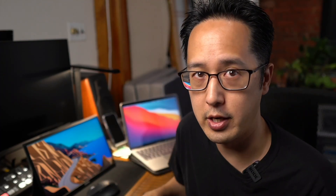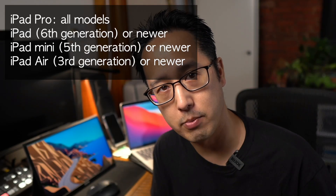Here's the scenario: I have my M1 MacBook Air hooked up to a 15.6-inch portable USB-C monitor — review coming soon on this one — and this is our base setup. Our goal here is to hook up a third monitor. The easiest way to get a third monitor with your M1 MacBook Air or Pro setup is using an iPad. I'll put the specs of what iPad you'll need on screen, but if you bought an iPad in the last couple of years you should be good to go. It uses the technology called Sidecar, and you can use it wirelessly or wired in.